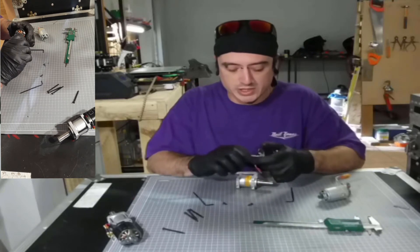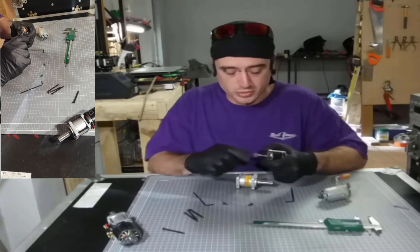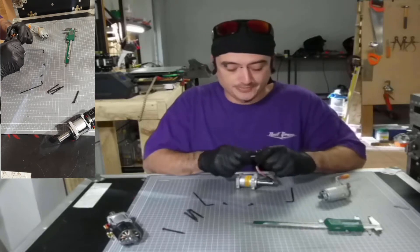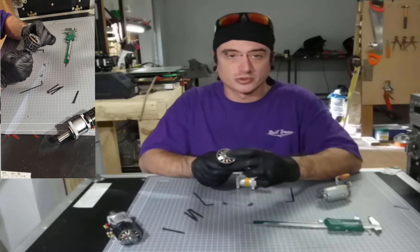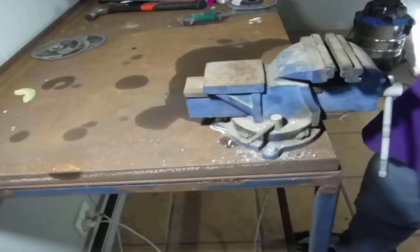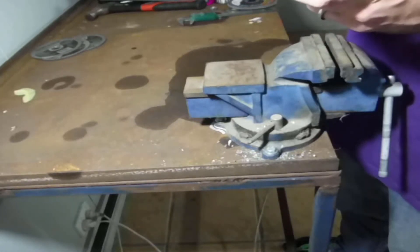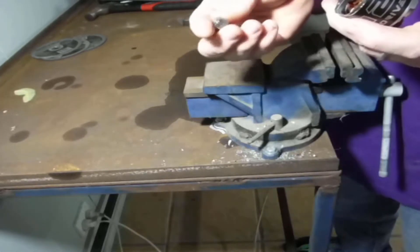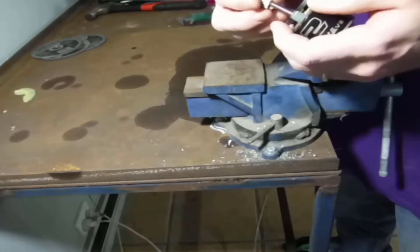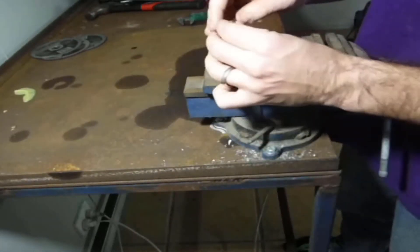There are many ways you can put this on. The proper way is with a pinion press, but I don't have one of those, so I'm just going to bash it in with a hammer and hope for the best. I need to support that end and hit it squarely. We've got to be really careful putting this in — there's a leading curved edge and a flat edge. Put the curved edge down so it meshes more easily, and make sure the bottom's flat.